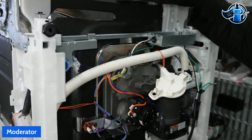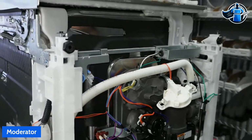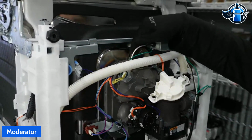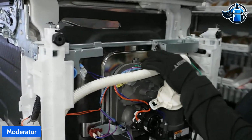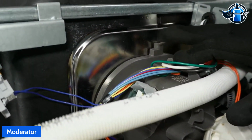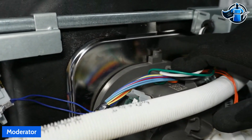So if you have any water in the tray, check your valve, check for any type of wave motion surging inside of the tub assembly itself, and then double check here. Now, I will say, when it comes to leaking out of this funnel on the sump assembly, this will take time to develop. This might not be something you see.